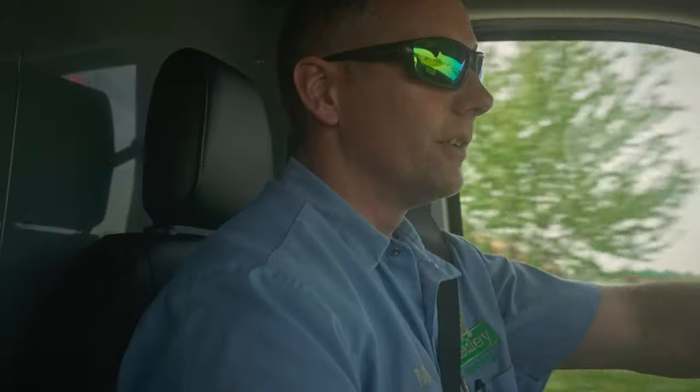Well, then also your torque converter in your transmission is also allowing quite a bit of slippage to make all of that happen really smoothly. Well, as that's happening, that's energy that your engine is putting out that's not being directly put to the tires. Therefore, it's robbing efficiency. The electric vehicle, with its regenerative braking properties, is considerably more efficient in neighborhoods, which is opposite of a gas vehicle.